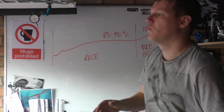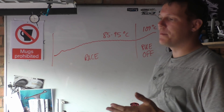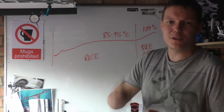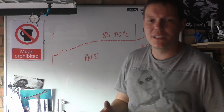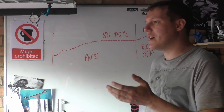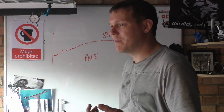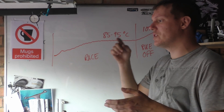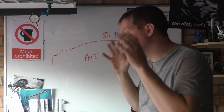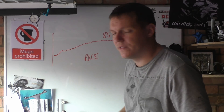Horsepower is one of the last things you need to worry about. What matters is: pressure data, vibration data, data from your knock sensor, air-fuel ratios, air mass, air temperature, air density, humidity — you can roll those into one — fuel flow rates, pressures, crankcase pressures, exhaust temperatures, exhaust gas temperatures. You can just go absolutely mad with sensors, and when you see these testbed engines it's crazy.